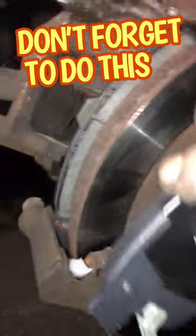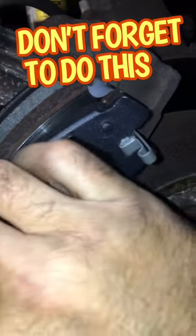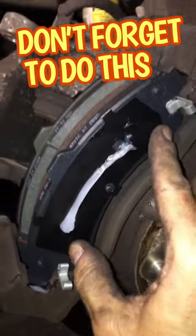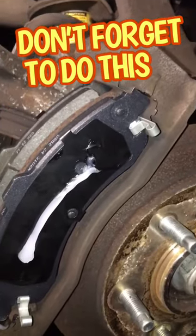Because as we see here, it'll allow the new brake pad to slide easily on those rails. And then what I do is I also put a little bit of grease here on the backs of the brake pads — not on the fronts where it meets the rotor, but on the backs where the caliper slides on. That way your rails and the backs are all nice and greased up.